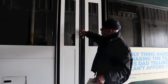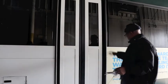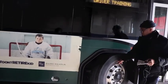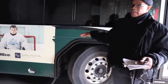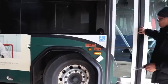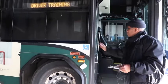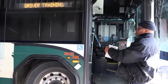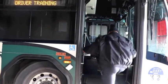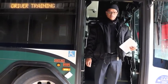Check the rear door — make sure it's properly mounted and secure and that the seals are intact. Check your turn signal, then get to the rear tire on this side and check it the same way as the other side. Then check the front door — properly mounted and secure, opens and closes. When you get ready to step in, keep three-point contact: grab both handrails, your foot, and step in. That concludes the exterior portion of the CDL test.